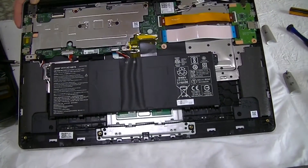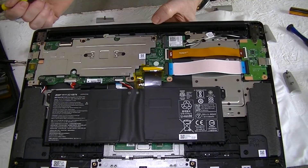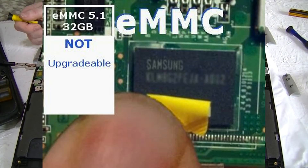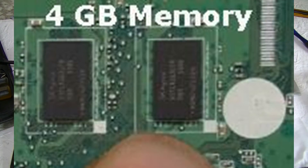What do we see? We see a large battery with speakers on either side. Above that is the motherboard, and in the center we see the large metal heat spreader — the CPU is located there. Here we see the Wi-Fi card with the two antenna wires attached. And I've labeled the IO board here. Under that large metal heat spreader we find the eMMC storage, which is not upgradeable unfortunately. Under that heat spreader you can also find the 4 gigs of memory, which again is not upgradeable.